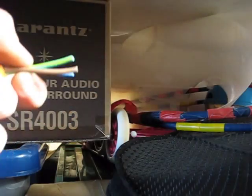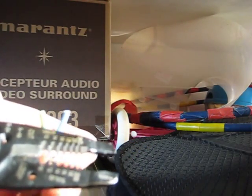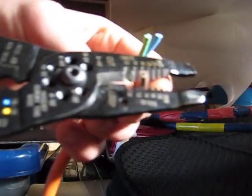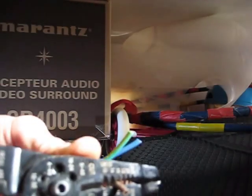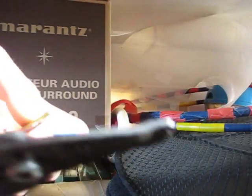Now get your up-sized cable strippers. You can see it on the gauge which size it is for the inner conductors. On this particular model, which is a cheap Trojan Bunnings pair, it's a 14. And this should strip without - there we go, it didn't even touch the conductors. That's just how you can strip the cable safely without making it unsafe.